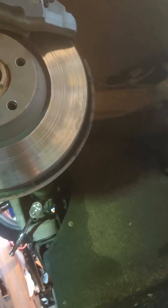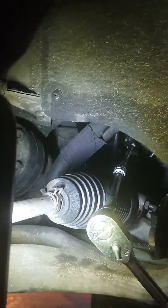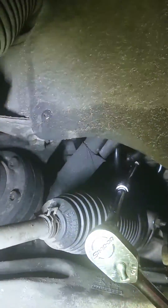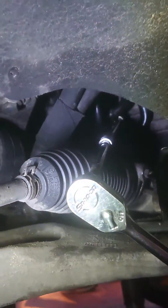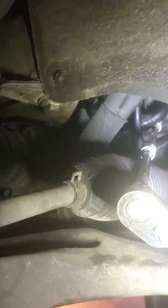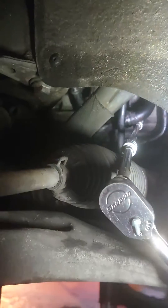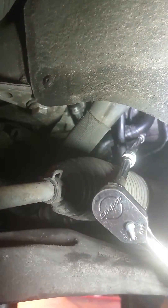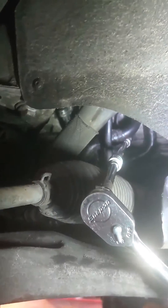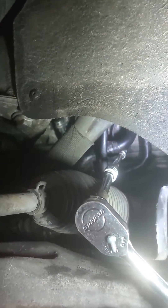Hopefully that helps anybody looking to find a crank sensor location. It normally causes trouble with starting when the vehicle is hot. The vehicle runs okay until you turn it off — the engine reaches temperature, goes off, the temperature raises, therefore going open circuit on the crank sensor. Leave the vehicle for 20 minutes, half an hour, maybe an hour, and it restarts — until it gets hot again and it stops. Those are the normal symptoms.